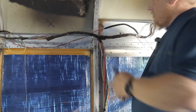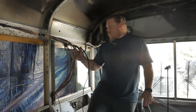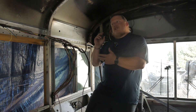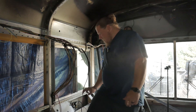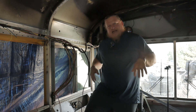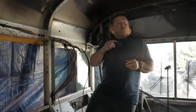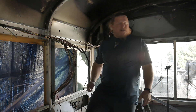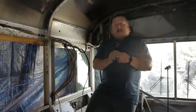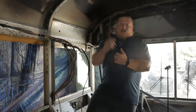You can see we got the bus tarped right now — kind of in monsoon season. I don't really need to pull this whole wire harness apart, but I wanted to make sure I don't have turn signals in here. The wiring for the front headlights, turn signals, and running lights I'm keeping — it's all very nicely jacketed and doesn't have all the crap I don't need. It's bundled with some of the stuff that goes to the dash, so I'm going to keep all of that together, basically replacing all the wires that go to the back of the bus as well as the loops for clearance lights and turn signals that go down the side.